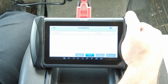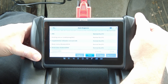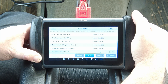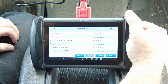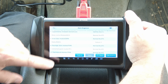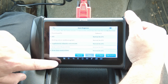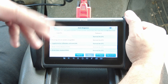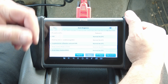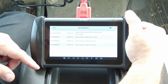Of course, I hate to make a scan tool video without showing the auto scan. I'll do a quick auto scan and fast-forward it so you don't have to sit through the whole thing — just so you can see that this tool also does the auto scan. All finished up: it shows one failure in the powertrain and three failures in the radio. You can highlight any one of these modules, click diagnose, and it goes right into that module to read trouble codes, reset codes, see actuation tests, and special functions. Or click report to get a report of all codes in the entire vehicle.